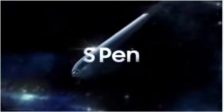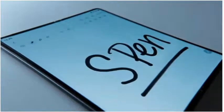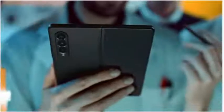The S Pen Fold Edition is designed with a new rubber nib that's rounded and soft to the touch. We also added an internal spring to act as a shock absorber, automatically reacting to pen pressure. So it smooths and softens any excessive pressure on the tip of the pen. We also increased the display's responsiveness to the S Pen by 40% to give consumers a smooth and steady handwriting experience.